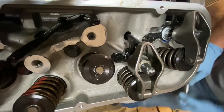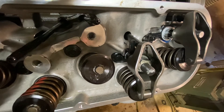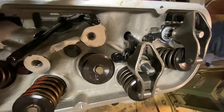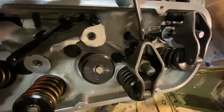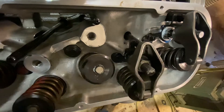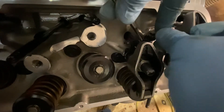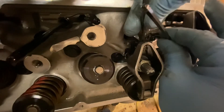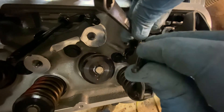On the compression stroke now — I'm hoping that they're still centered. And I'm standing over here looking at them. They are perfect. Now here's where you get screwed up if you're moving too fast, which I did. You need to tighten this center bolt, and that will lock this guide plate in place. If you don't, the minute you take this off to tighten and retorque your studs, all this is going to change. And you're screwed. It's easier without a camera in the way — I'm way more graceful when the camera's not on, I promise.